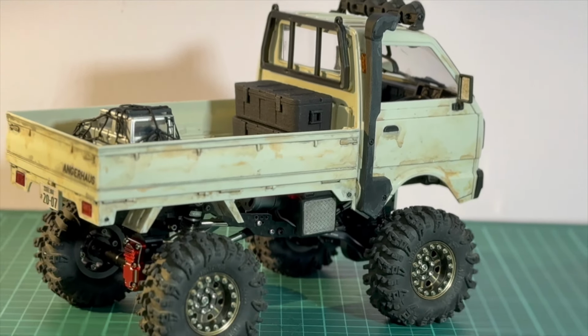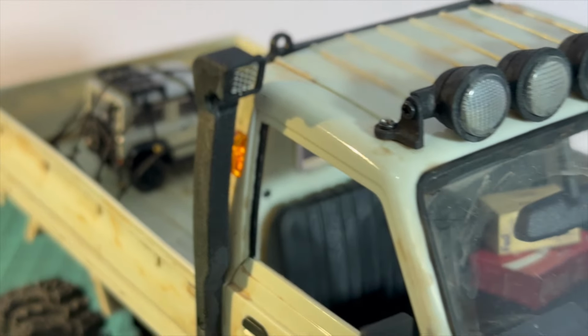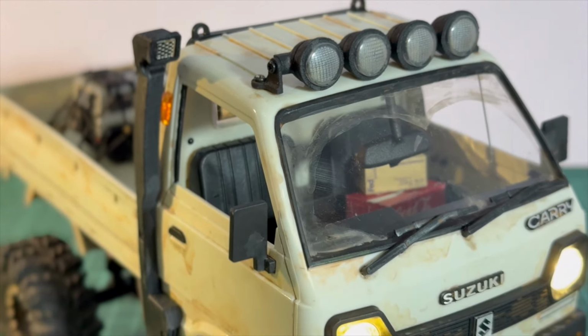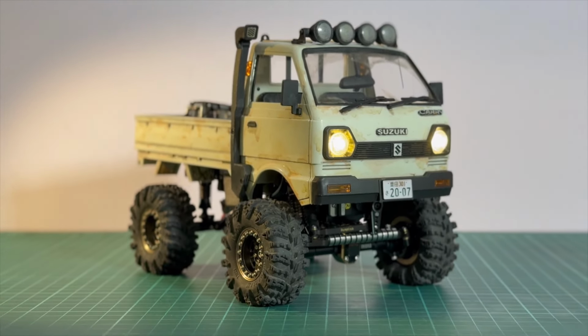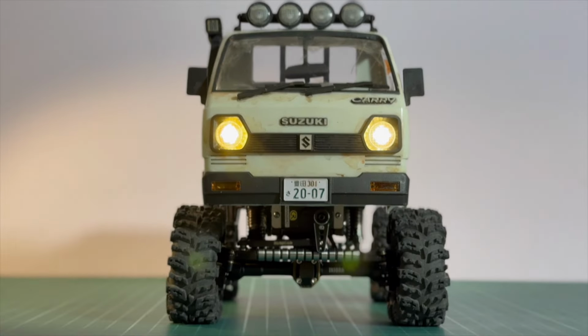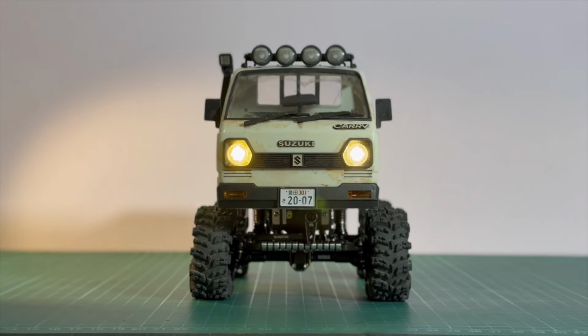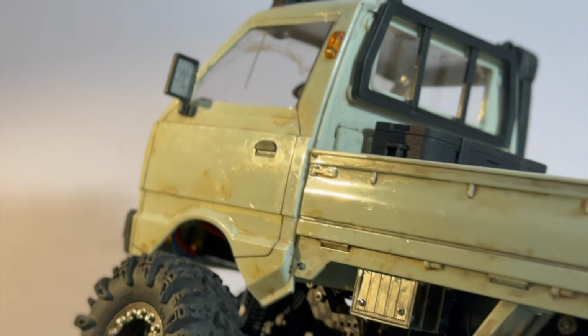I also find the servo gets extremely hot. Maybe it's a bad idea to use this ESC without a BEC. I thought the specs from RampCrab says it can support up to 8.4 volts. I guess not. I'm not sure at this temperature how long the servo will last. Oh well, we'll figure something out for this truck later.